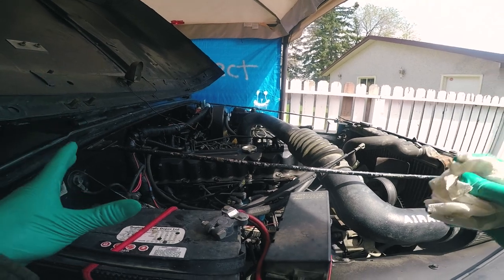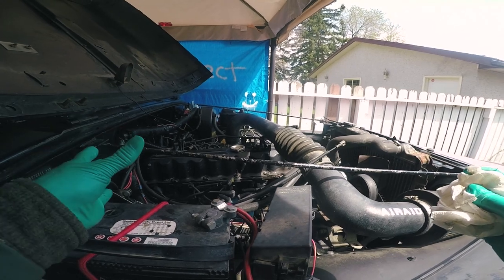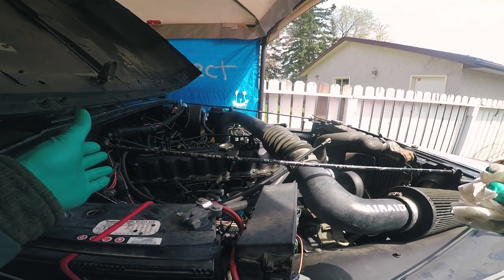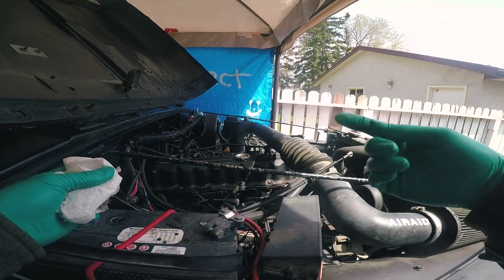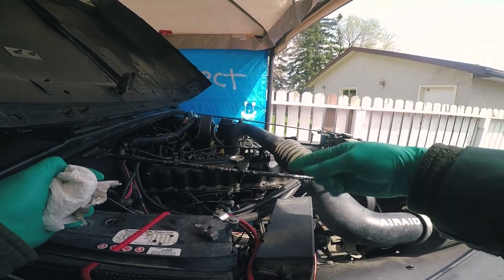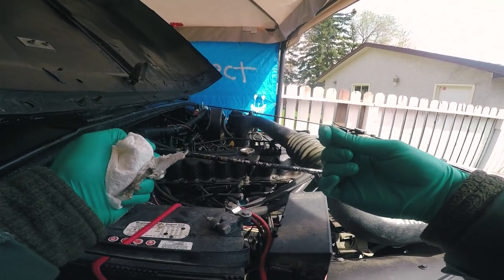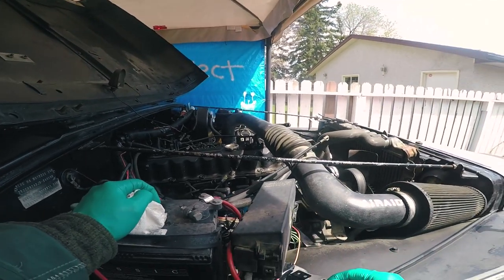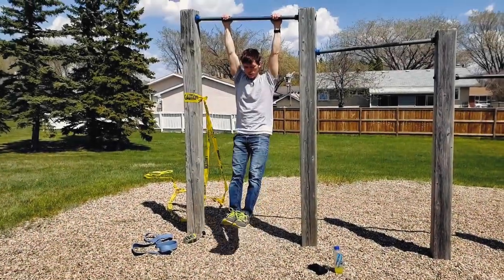My biggest concern is that I lost power on the highway. You're driving along, you lose oil pressure, the vehicle starts slowing down even though you have your foot on the gas — you can floor it, you can change gears, you're not going any faster. Because what's happening with a spun bearing or lack of oil is you're fusing the metal together, and it's getting harder and harder to turn the engine to the point where it seizes. And I think I narrowly avoided that by getting a spun bearing and shutting the Jeep off.